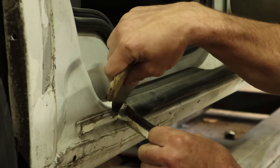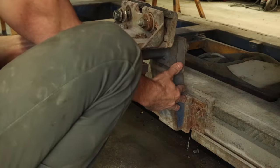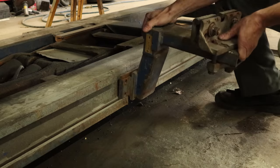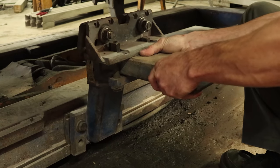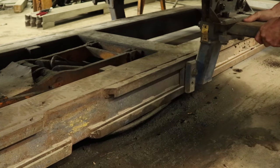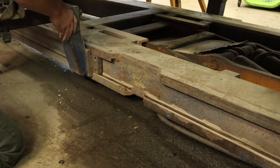Now you can remove the sill plate out of the right rear door — there's just two-sided tape down. Now it's time to put the clamps on. Every frame rack is different; these just drop in the center and slide to where they go. We had to take the rocker molding off to get to our damage, but you also have to take it off to get these clamps on — at least you're supposed to. I'm lazy, so I don't.